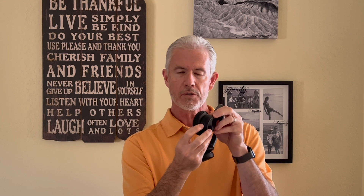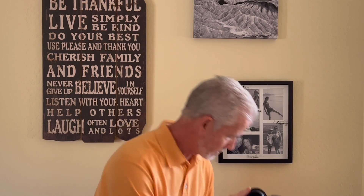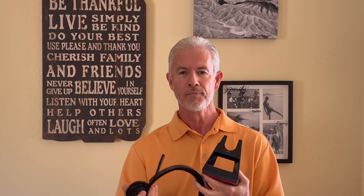The headset has an on/off button that also acts as a pairing button. Push that all the way up to get it into pairing mode and you will hear the headset say 'now pairing,' and it will start flashing blue and red as well. Once the two connect, you'll see the headset go blue and the base go blue. You'll hear the headset say 'pairing successful, base connected.'